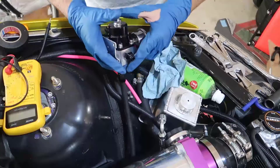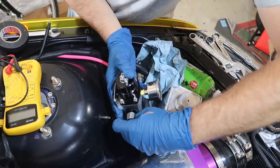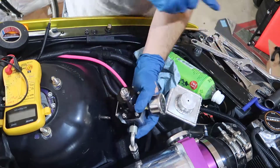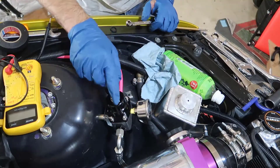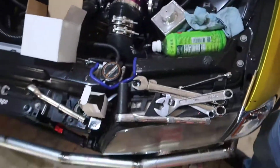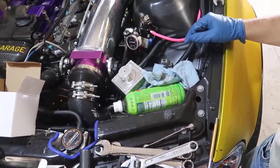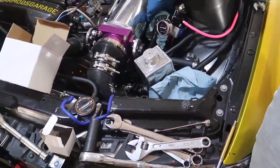Getting the last line in - boom - it should be pre-configured for 43 psi, that's usually what happens. Lines are tight. I just need to plug the fuel pump and see if it leaks anything. I'm gonna put a paper here.